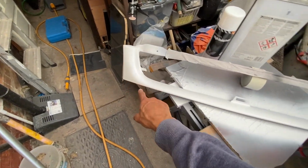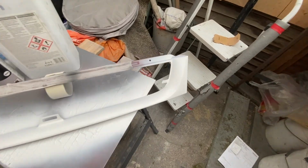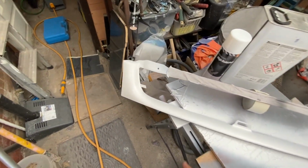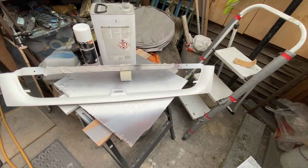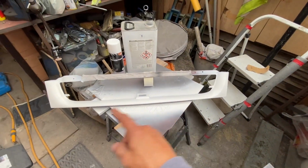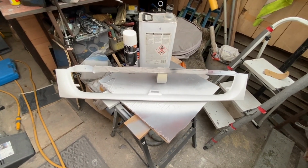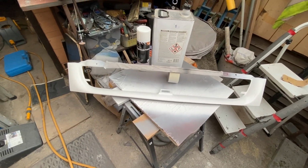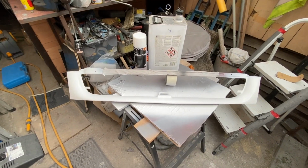As long as the main faces are all right and that bottom edge, that's all that really matters, which is a great chance for me to practice blending and a bit of a soft edge, because I have no idea what I'm doing, so just winging it. But really happy with that. So I'm going to leave it half hour to dry off, and then just going to go over with, I don't know, probably some 600 grit or something, 800 grit, and then we can go on with the base coat, which is Colorado Red LB3Y.